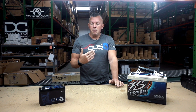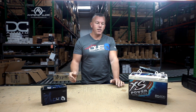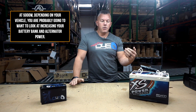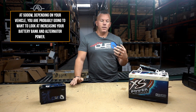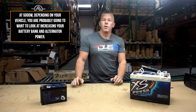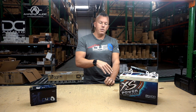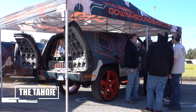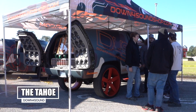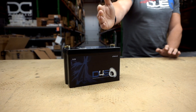If we're going up into bigger power ranges such as 5,000 watts, 8,000 watts, or 10,000 watts, then you're going to have to start increasing your battery bank a lot, because the power draw is a lot more substantial than a 2,000 or 3,000 watt amp. You're going to want to start multiplying your battery bank, and if you can get more alternators on your vehicle you're going to want to start doing that too, all the way up until you get to something like my Tahoe.